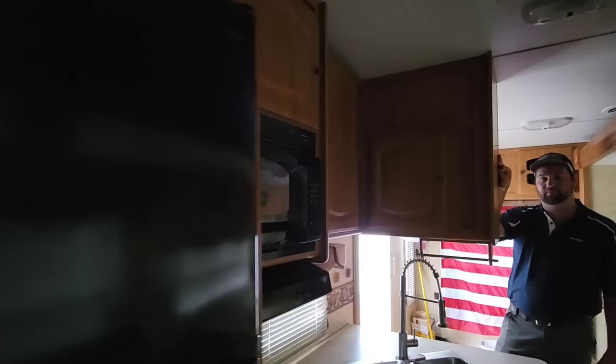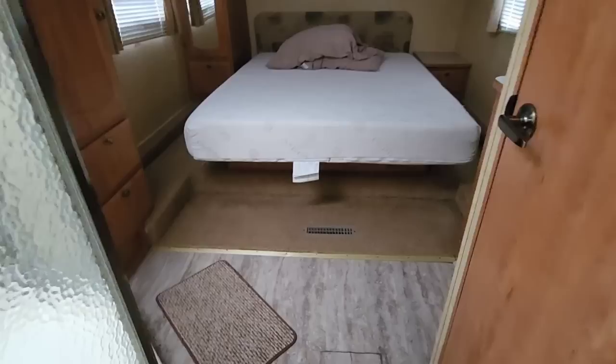This looks like a 12-volt refrigerator. That is actually a residential refrigerator. I fabricated the top cabinet doors to be able to fit it — I had to take one shelf out, but I was able to cut, flip the hinges, and it slid right into place. The reason I went with that over an RV-style fridge is because I never camp without shore power. And if you open it up, you'll see the sheer size difference between that and a typical RV fridge. It seems like some of the newer 12-volt fridges like Ever Chill would actually rival it too.